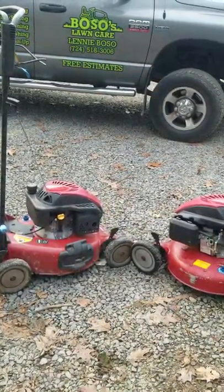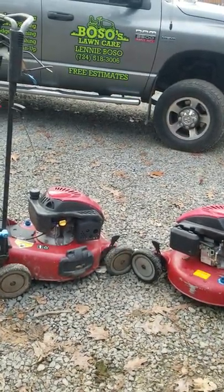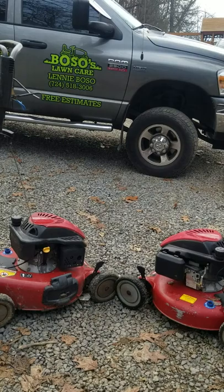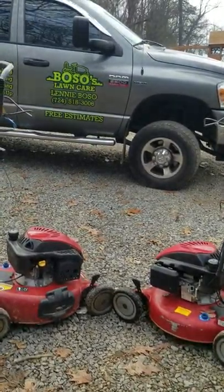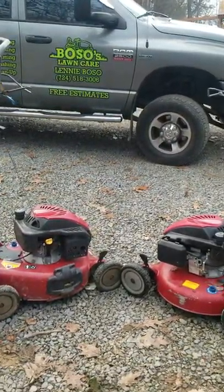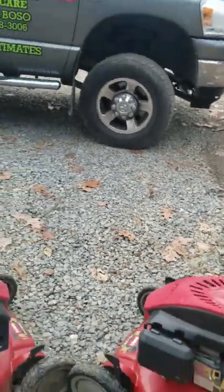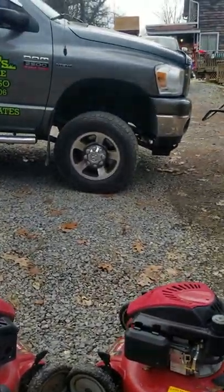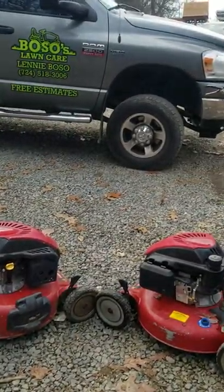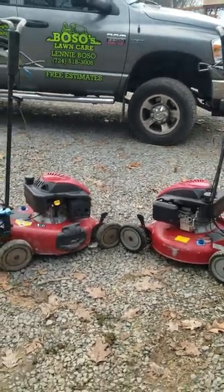For being a residential-style mower, they are fairly reliable. They cut good, they stripe — most of my push mower yards they do lay a little bit of a stripe. Some are better than others, but that's just the type of grass. They are light — they are aluminum, not steel. Those are aluminum decks on them; I believe they're cast aluminum. Height adjustable right there. They've been a good mower. I keep the oil changed twice a year — at the beginning of spring and then right around the Fourth of July. All my mowers get done around those two times, no matter what the hours are on them.